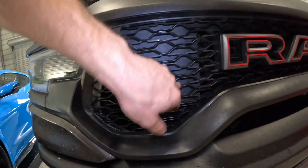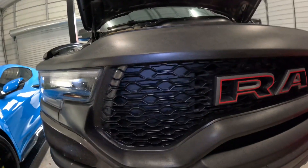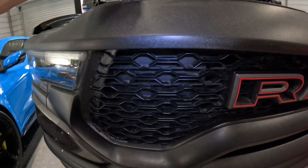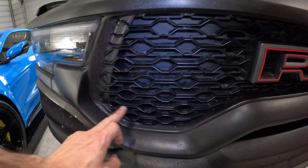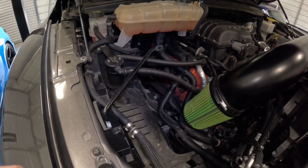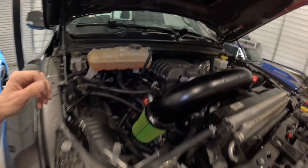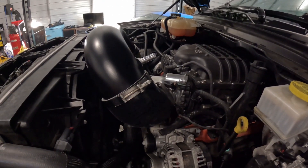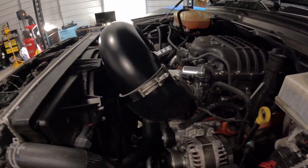If you want cold air, there's a big plastic piece where your radiator is, and a lot of people cut that out — they also do each side and put little yellow lights in there. To get good airflow, I'll probably end up dremeling that out so air runs directly through to the intake. It'll be colder — not true cold air, but better than hot engine bay air. That's the only downside I can see. Everything else is pretty straightforward. I didn't have the clamp for the larger throttle body since this was used, but hopefully Rip-a-Tune includes both clamps when new.